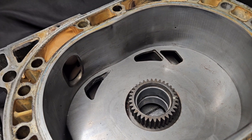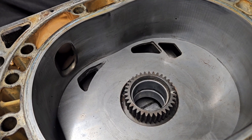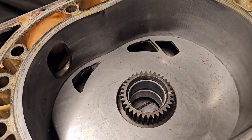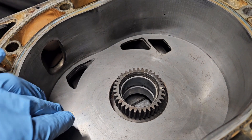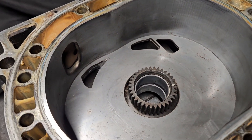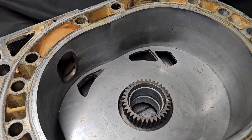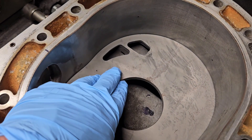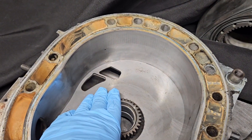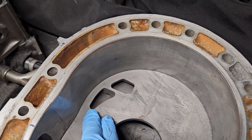We didn't know the exact results, but when we did get good horsepower numbers out of our boosted combination, we had the mindset that we knew it was going to work. There were some unknowns, like what's going to happen with the exhaust flow on your side ports. But it was never a concern of whether we needed to close them off or if it was going to be better to just run peripheral exhausts. Part of how we knew this combination was going to be feasible was that in the late eighties and early nineties, Mazda had already produced the RX-7 six-port. I think a lot of the times it gets lost in the rotary world, but the intake configuration that the Renesis engine has is a modernized version of what we had in the late eighties and early nineties.